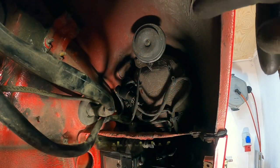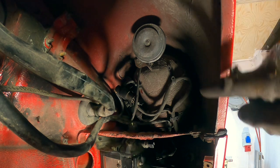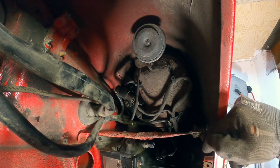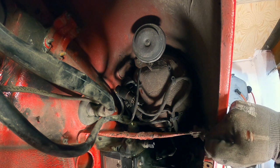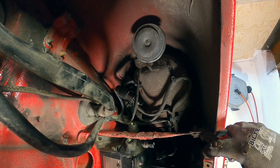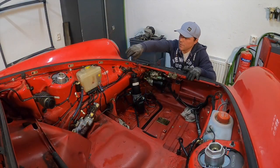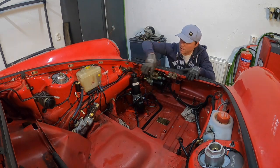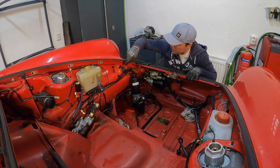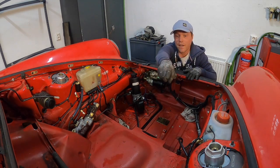There are three horns in total — one must be for the horn and two for the alarm. Some connectors for the cables going to the front lights and the front section of the car, and of course we have the oil fan here. In my setup I'm going to have one connector to the oil fan and control it using a PWM signal from the PDM — so much less cabling. I'll still need the lights and a horn, but all the rest goes. The cables in the front start at the central electric, pick up the wheel sensor, the brake fluid reservoir, the lights, some ABS stuff, go around to the ABS brain, go out for the fender, and come back to the central electric.